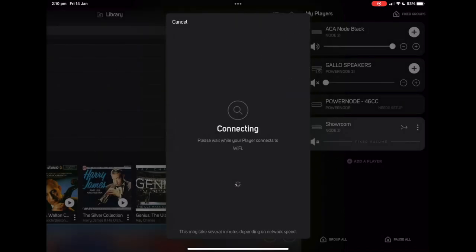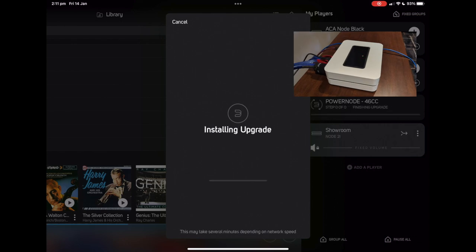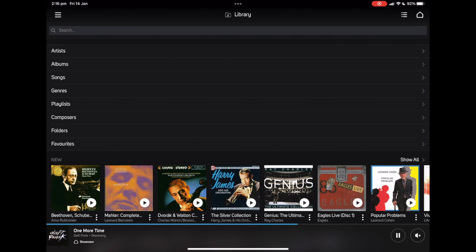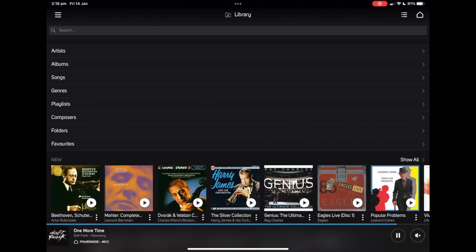It's a lot easier than it used to be. Once it's on the network, you'll see that it will download a mandatory update and the status light will flash from red to green while it performs this upgrade. This won't take that long — maybe three or four minutes. We've sped it up for this video, but it won't take long at all. And that's it. If you did nothing else, you'll have a functioning streamer on your network. You can see the streamer we just set up on our network in the groups menu — this is also where you can group zones for party mode.